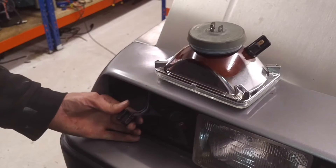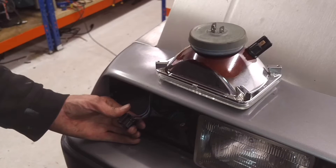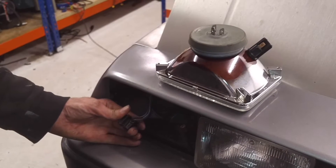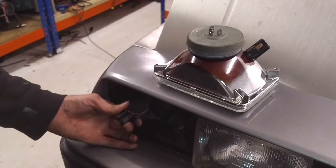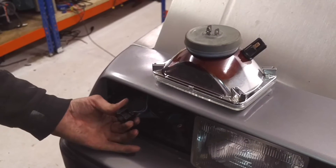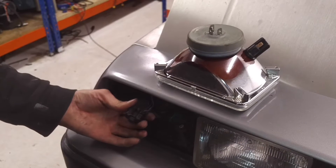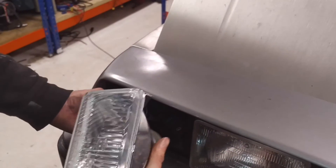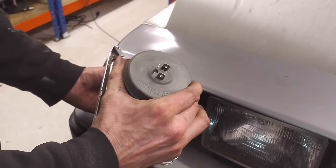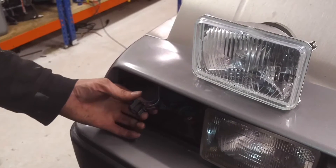I'd like to talk about headlight wiring because it's something that seems to come up all too often, even on television — cars that have supposedly been restored have still got their headlights wired wrong. The original wiring can still be used; in fact the connector is exactly the same, it's just now the other way up and with the pins in a different order. This is when switching from the original sealed beams to a modern H4-based headlight, which we have to do in the UK because we need our beam pattern correct for our annual test.